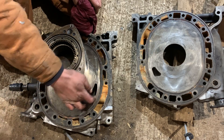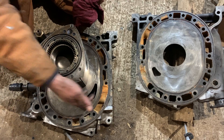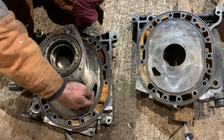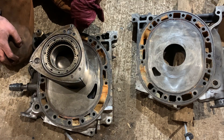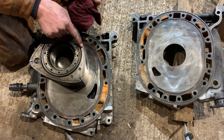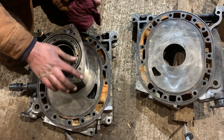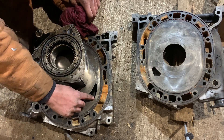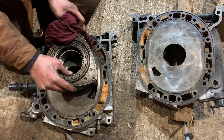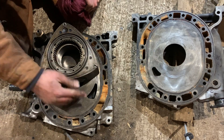If you port here a little bit — as I did — I have exposed these corner seals to just the port. However, it wasn't drastic enough, so I'm not going to have problems with the corner seals actually falling into the port. Also, whenever you open up down here, when the rotor is actually rotating, a bit of the side seal is going to be coming out. If you do not have a sharp but smooth closing section here, when it's spinning it's going to come in contact with your iron and snap it off. So you need to be careful.